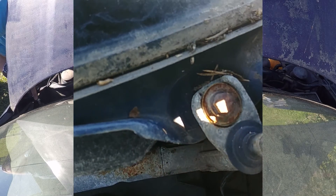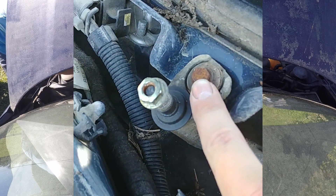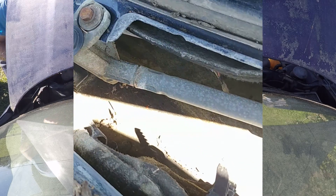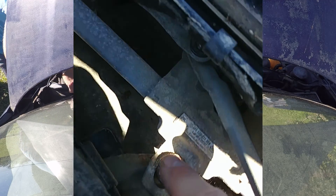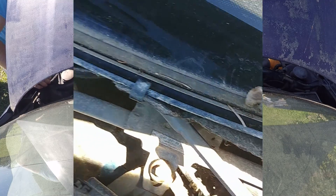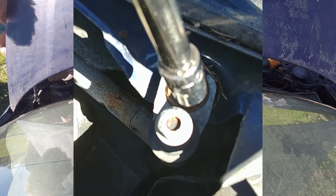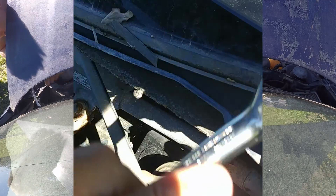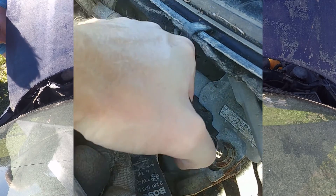I won't show you removing it from the donor car, but I'll just show you here that there are just three bolts that hold it - one there, one down here, and one there. The only other thing you have to do is unplug the motor which is back under here somewhere. These bolts are 10 millimeter hex so they should be very easy to undo. The torque value if you're going to go by spec is very very small.